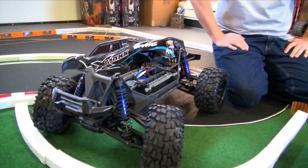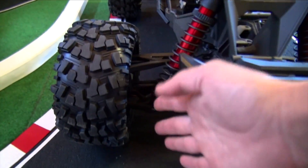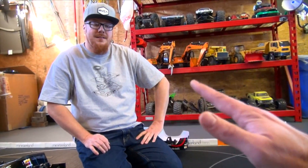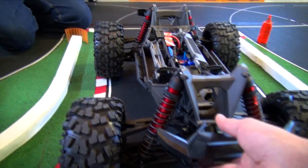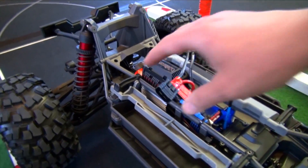One of the things I think we feel mutually about these cars — the first X-Maxx that came out, 6S was amazing. The self-righting system was great. But the 6S actually seemed a little bit sluggish. It felt like it just needed a little more. When driving it full out, you just wanted a little more. When I used the self-righting system, I noticed I was snapping CVs. That's a problem because the whole way it self-rights is it spins those tires and rocks to get back up on the wheels. They've beefed everything up now — the drive, the diff, the center, everything.